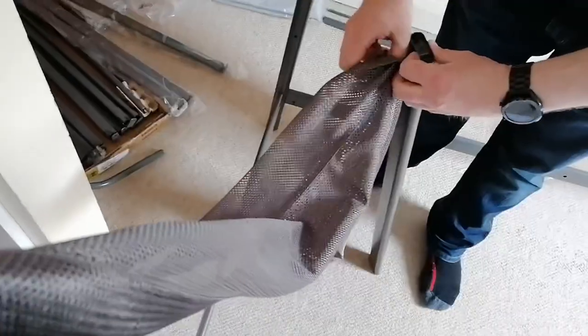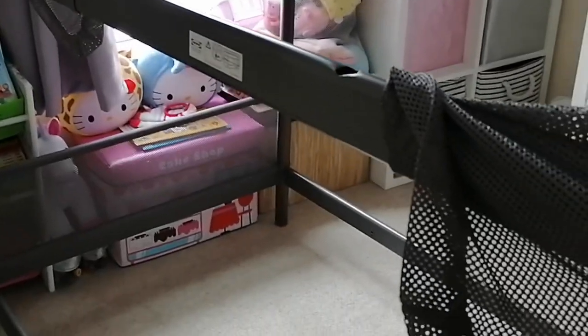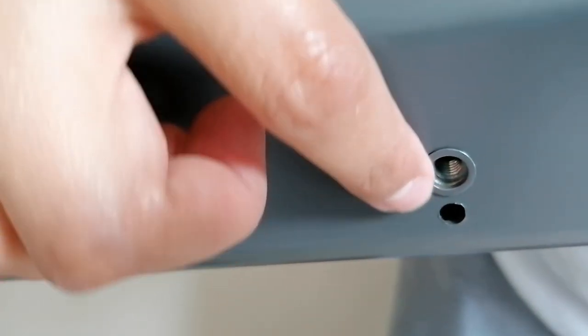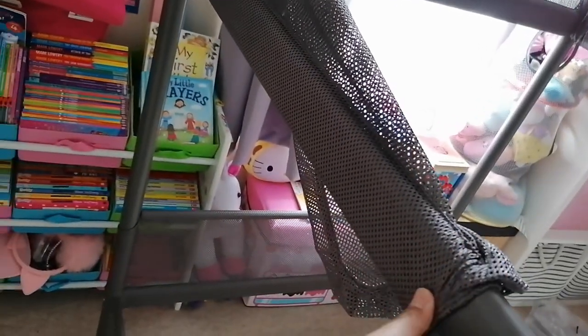We finished the long ends, so we're just going to do the same now for the shorter ends. The same flat metal, except shorter, and then we put the round ones at the top. Once you've got the sides up, it's time to put the bar at the front. Make sure the hole positioning is like this — the two holes are in the middle. Small hole at the bottom and big hole at the top. Insert it first through the mesh and then screw them in.